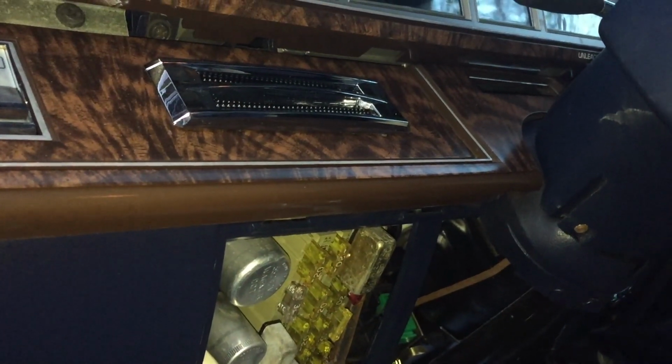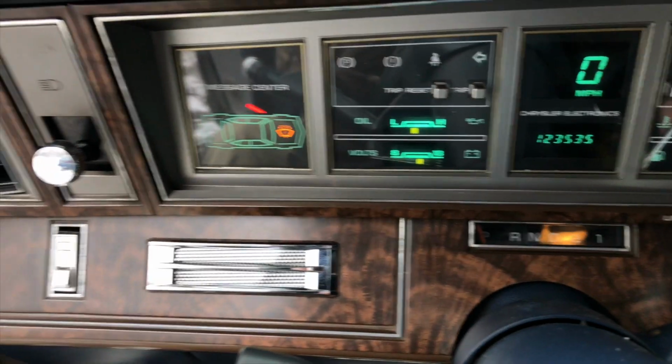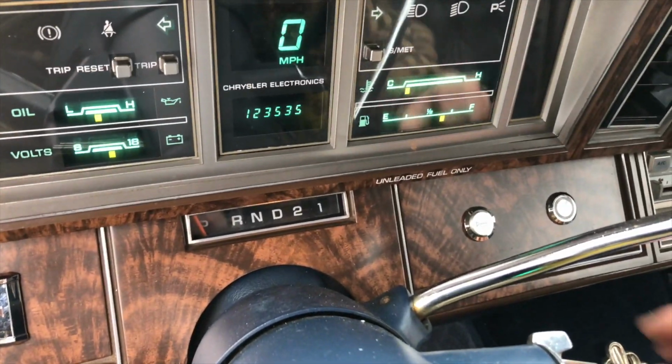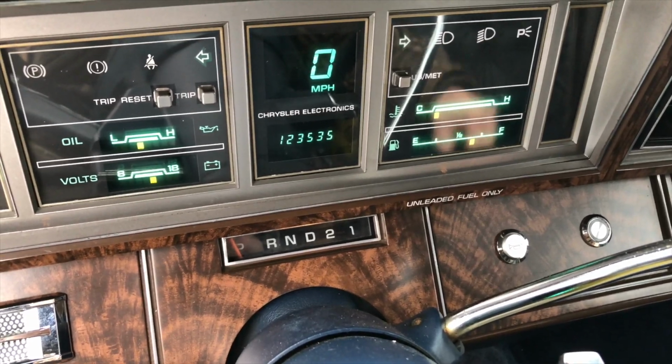I went to reinstall the dash panel and it just wouldn't sit flush. I then discovered the fuse panel is directly behind the buttons, and those buttons wouldn't allow enough recess of the dash panel to fit. I had to gently scrape off the other chrome stick-on piece without destroying it, move it over top the already drilled holes, re-drill new holes on the other side, and reinstall the buttons.